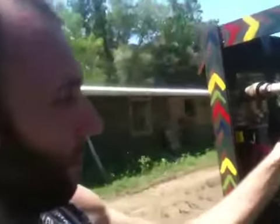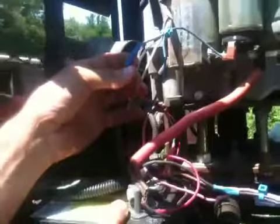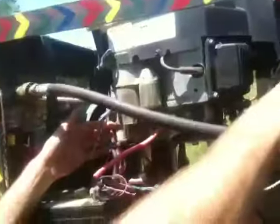And then the purple wire is coming out of your voltage regulator. The purple wire, I've connected it to this red — straight to the battery. Okay, charging straight to the battery. Yeah. The blue wire goes to the starter position — the starter. These are labeled with letters on the back. Yep, got it. So that'll be start.